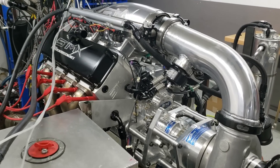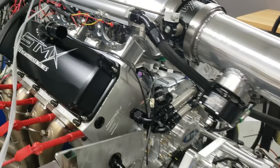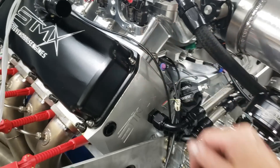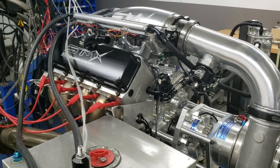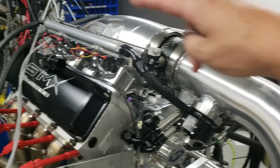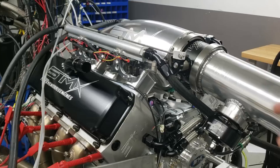540 cubic inch. This one in particular — he already had Holley in the car and wanted to stay Holley, so that's cool. Holley billet atomizer, twin 700s. Because Tony's not going to be doing any driving on the street, but we can if he wants to. I can just put the third set of injectors in there and run it on pump gas or whatever he wants. All of my intake manifolds are set up for three injectors, so it still just has blanks down there. He can plumb it if he wants and use those rails for part of the plumbing, exiting and inputting from the front.